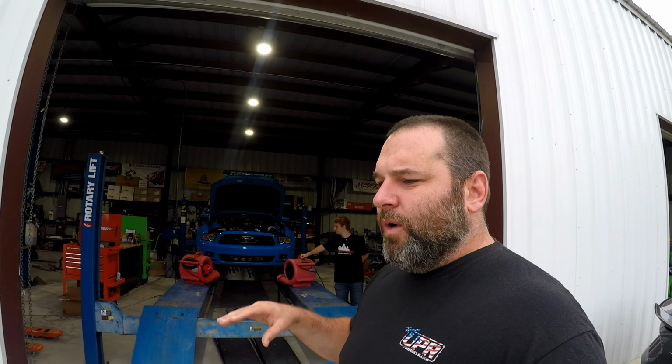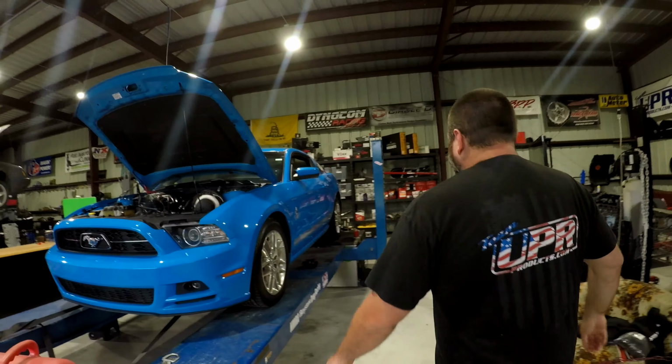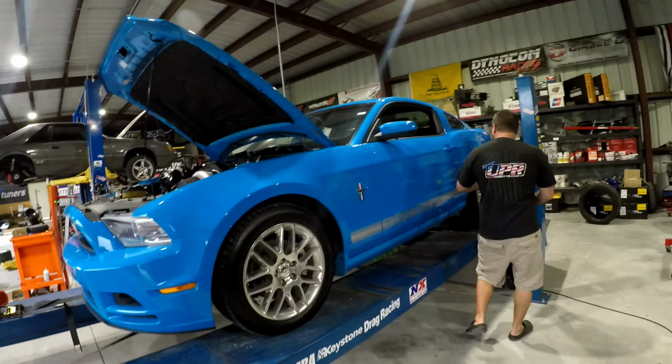I do have to say that with our catalytic converter system, and that's a Y-pipe, it goes down to the 2 1/4 stock over-axle exhaust. My recommendation, guys, is to go with 3-inch all the way. Maintain the cat so that you're EPA legal, but go 3-inch all the way out to a resonated or muffler system. In my opinion, the Roush doesn't sound that great once we get going, but at idle, it sounds pretty freaking good. You want to fire it up, Cody? Let's fire it up and see how she goes.